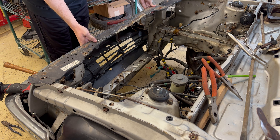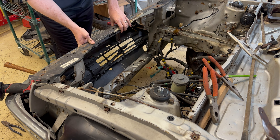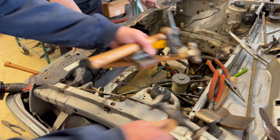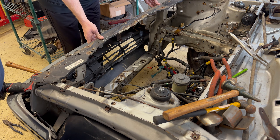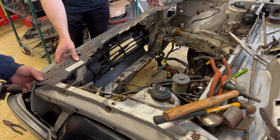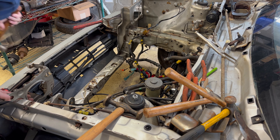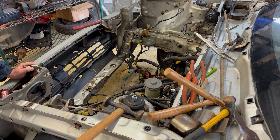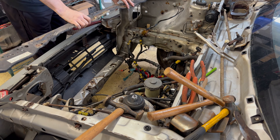You could tell when I put this piece on here that the headlight bezel needed to come back. You can kind of tell right now how far forward it is, but the passenger side was good — it was just the driver's side. See how far that's out — about that far off. This side fits just like this, but this side needs to come in because this is bent right here at that spot. Just using it as a reference to see how far we need to go. Pounding that side in so we can actually get that to fit underneath the core support on that side.